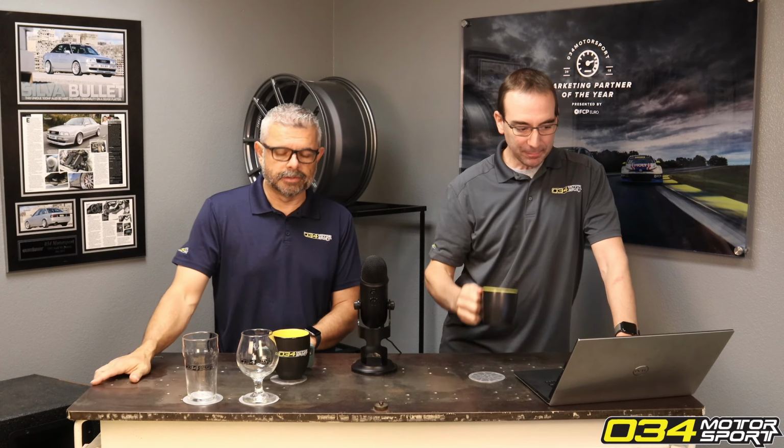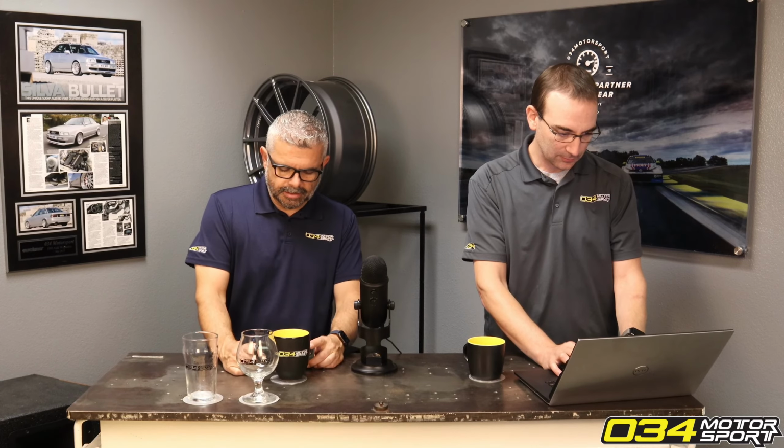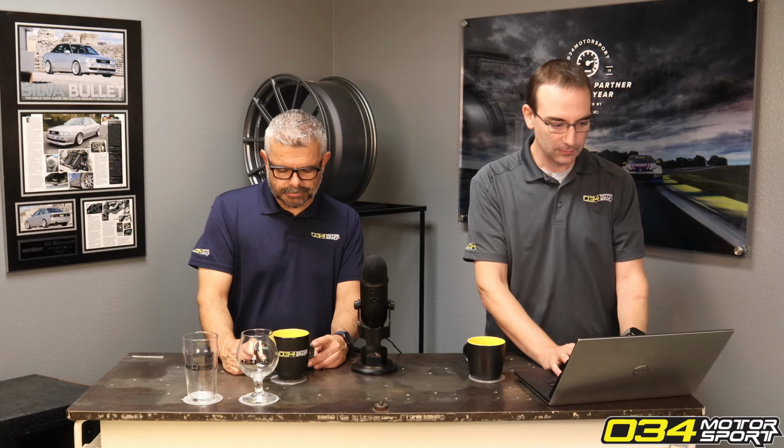Generally, I don't think ceramic coatings are necessary for a properly designed installation. Certainly heat shields play a key role to keep the ambient and radiant heat away from other components that are more sensitive. You can use heat shields made from metal, and there are a lot of reflective, aluminized heat shielding materials available these days. You can make a sheet metal structure and then coat that with reflective heat tape. There's lots of things. If you have something specific, feel free to send it our way.